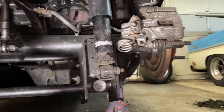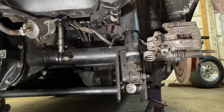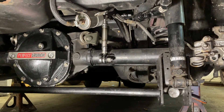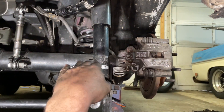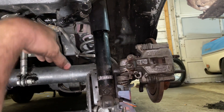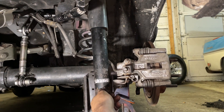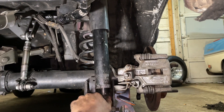Right now I've got them all the way tight - see how that rear end is still slowly creeping down? See how slow that is with both completely tight. You do not want it to spring up real quick and top the shock out, because it can spring so fast that it lifts the back tires and lightens the pressure, causing a spin. You want to control how fast this rear end does what it does.